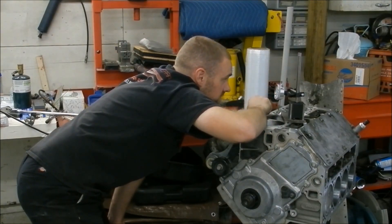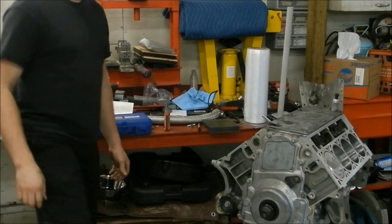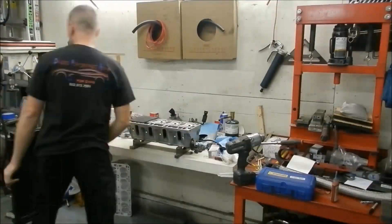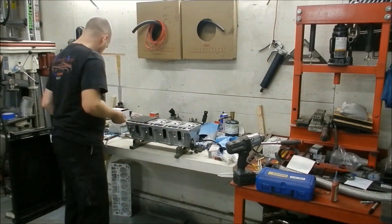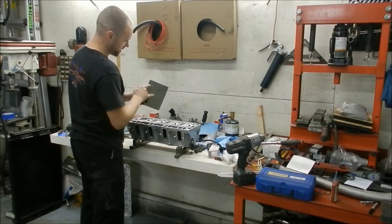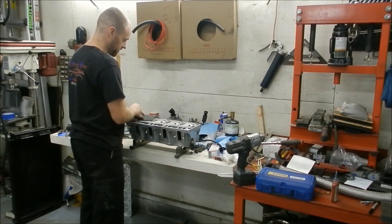About 20 - yeah, 20. So we got 20 on that one. We'll get this put away and CC some cylinder heads. That's another reason I usually do this before putting the motor together - so I can say take 10 off this side, take 5 off this side to make them even. I'm going to CC these heads. I have two holes in this plate: fill from one, let the air escape out the other. I'm going to set this on the head with a little grease between the plate and the head for a seal.